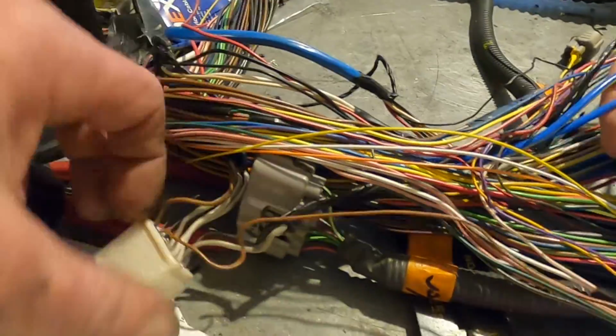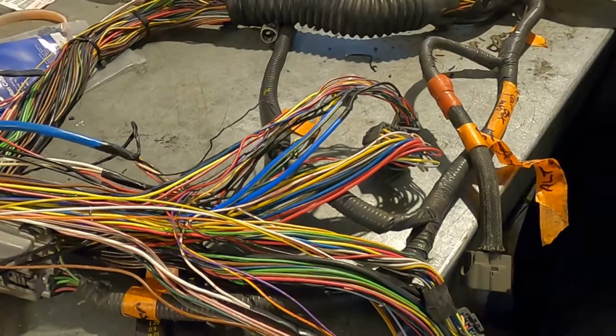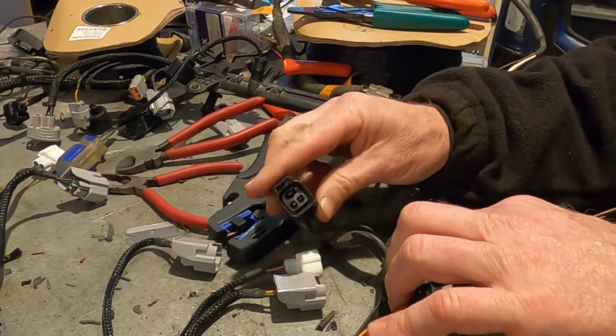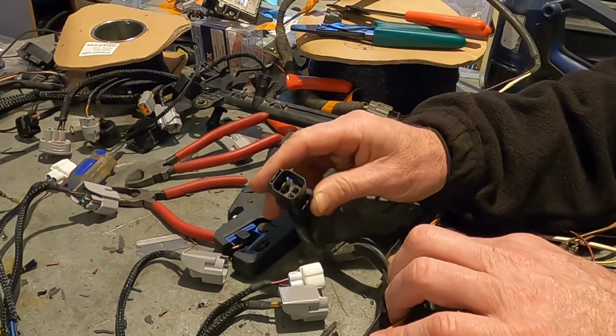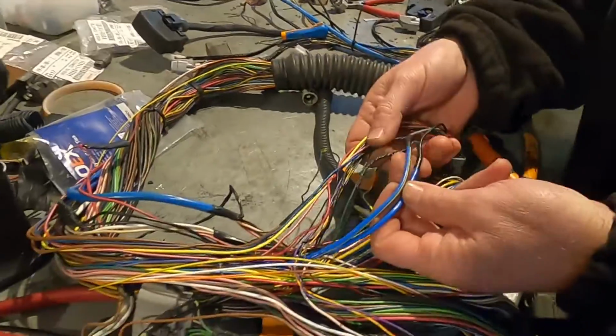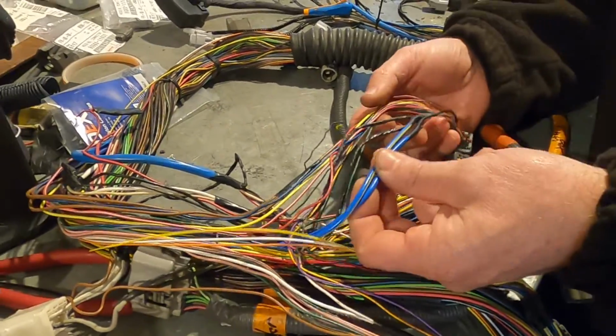So those are our knock sensors, which come from up here. So here's knock sensor, start, trigger plug. And there's our blue, yellow shielded wires. So your shielded wires are for anything of a critical type of signal. If it gets any kind of interference, the ECU's not going to be able to see it properly. Correct. So that's those two.